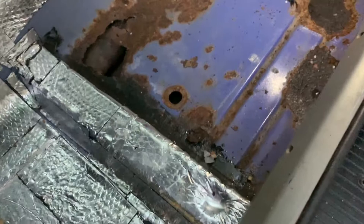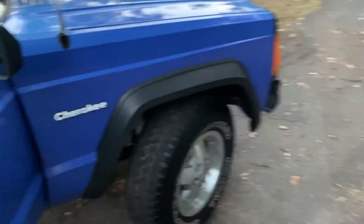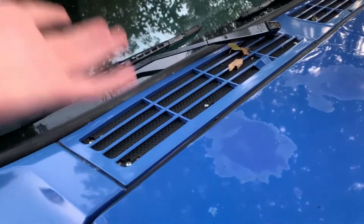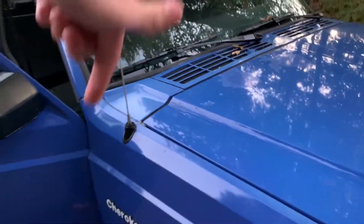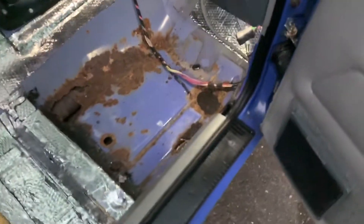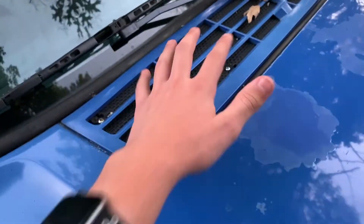The rust situation — you saw this in part two when I pulled up the carpets. There's a bunch of rust from the cowl leak. The cowl leak is a known issue on every Cherokee from around '89 to 2001. There's a fresh air intake duct underneath the cowl, and the seal around it cracks and gets brittle over time, allowing water into the cabin. It comes in right under the blower motor, sits on the floorboard for years, and causes rust very fast — it also destroys your carpet.